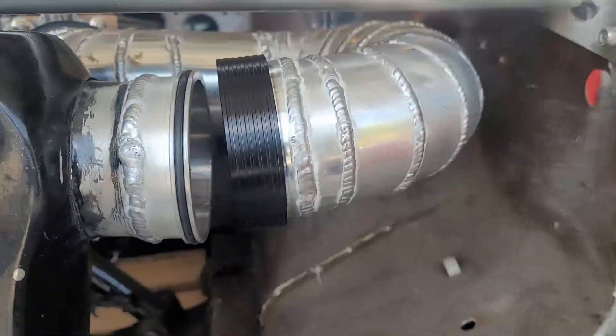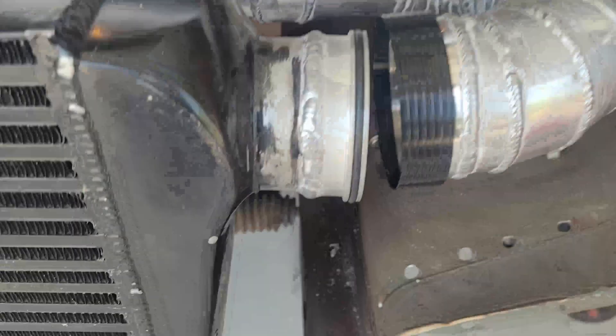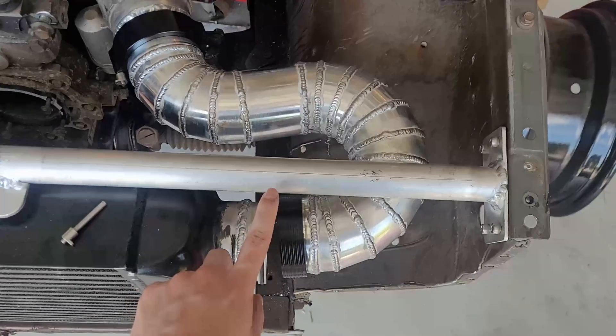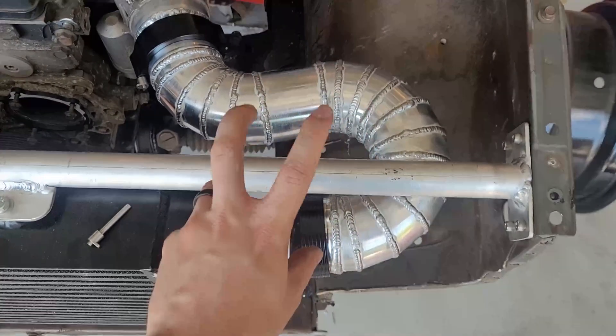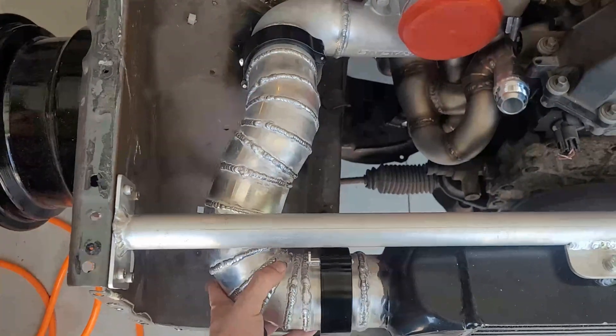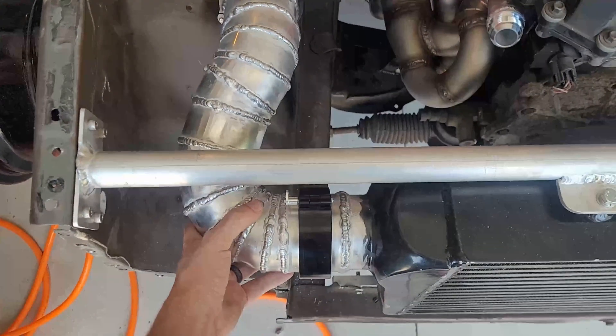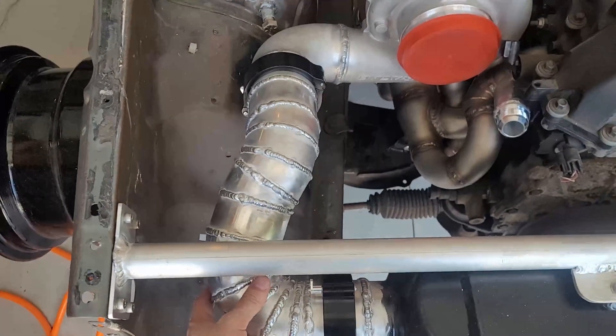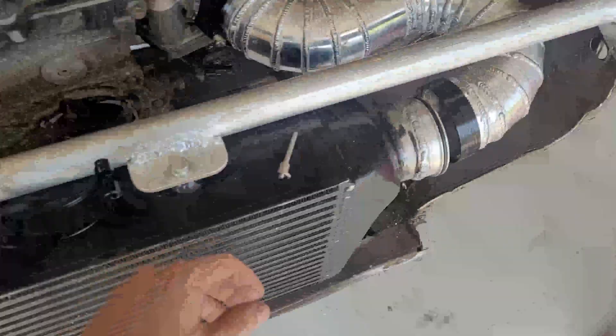All this collar piece is doing is keeping the two halves from blowing apart while the o-ring does the actual sealing. These are rated for 100 psi. If you buy from a US-based distributor they're about a hundred bucks a piece, or you go to Amazon and they're thirty. These are Amazon specials. The benefit is they can't blow apart, they're essentially hard lines without being fully rigid — they still allow some degrees of movement, rated at about seven degrees of play in any direction.